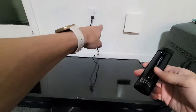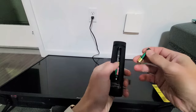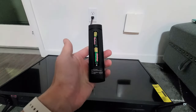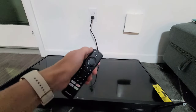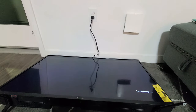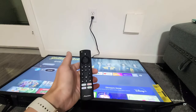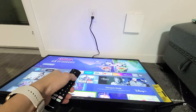After you've plugged it in for 60 seconds, go ahead and put your batteries back in — make sure they're in correctly. We don't have to put the cap or lid back on the remote yet, because sometimes you have to do this twice. Now I have my batteries in, so let me go ahead and turn the TV on using the power button. Just wait for the TV to boot up. When it turns on, see if it's paired. If it's not, press the home button once and see if it is paired.